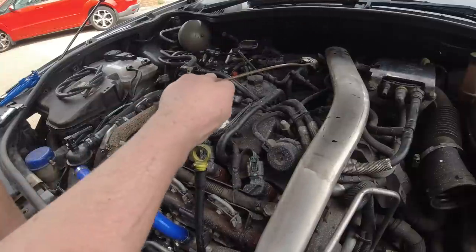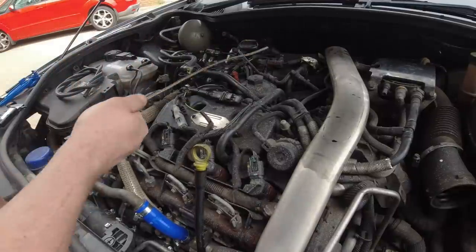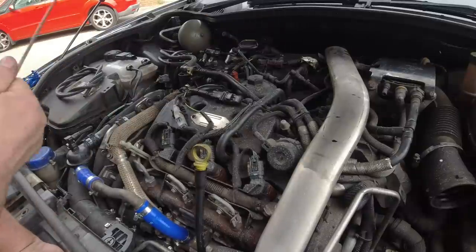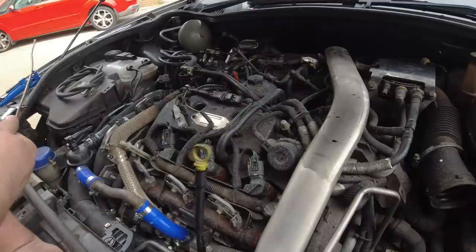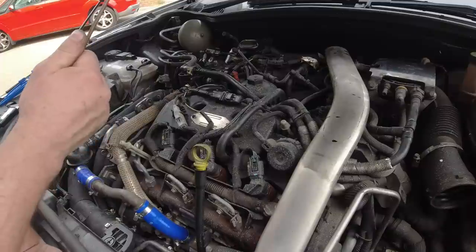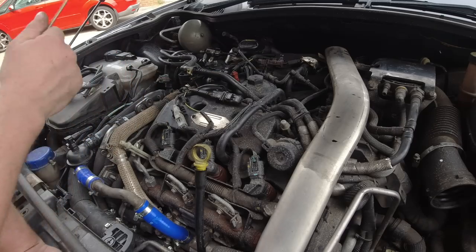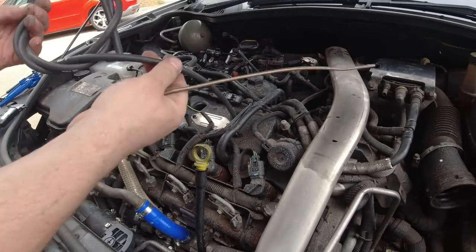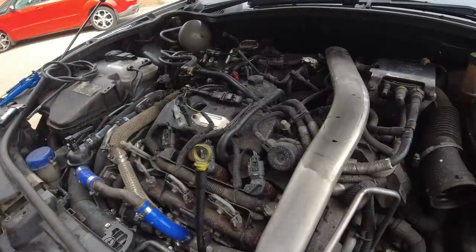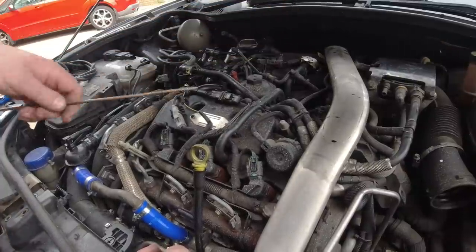Anyone asking why am I not just attaching a piece of rubber from there over to there, I did consider that, but I don't know what these pipes actually do, because the descriptions of them are just, some people say breather pipes, some people say boost pipes, some people say vacuum pipes. I don't know. I suspect they're vacuum, and if they are vacuum, because they've not got any fixings on to hold them on, so I'm guessing they're vacuum. And if they are vacuum and I put a piece of rubber all the way through, although this is supposed to be vacuum hose, there's a chance it would suck in on itself and seal up, and I don't want that. I want all my boost. So at the end of the day, they're rigid for a reason. It's just they've made them out of something crap, not something useful.